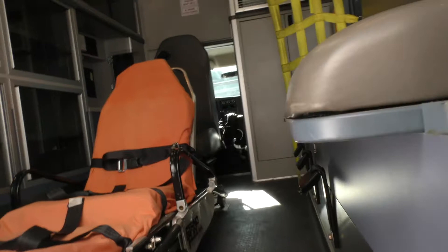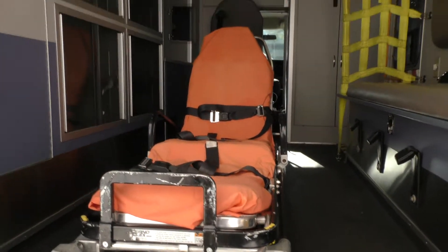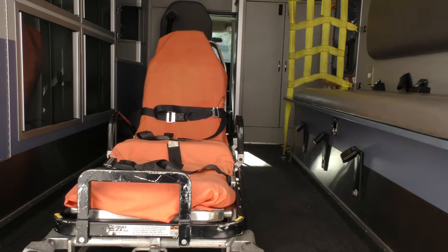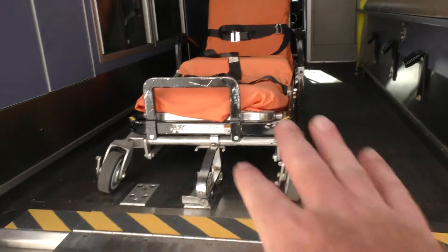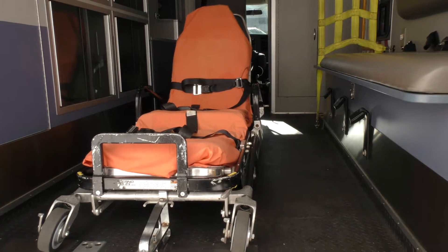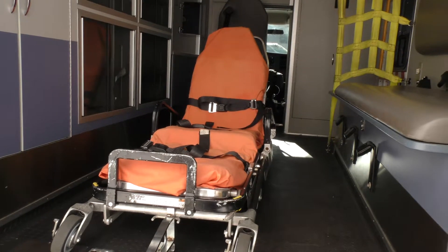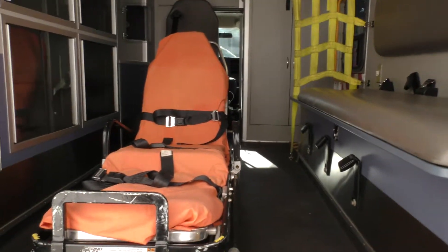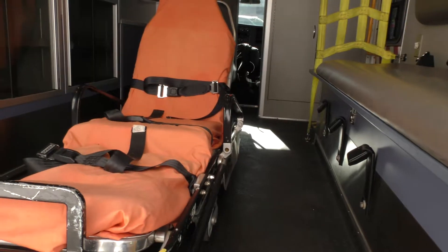It does include a gurney. This ambulance is set up for a one-man gurney — it's a Ferno Flex 2033. If you're familiar with the Ferno Model 28, it's a variant of that. It's called a one-man gurney because it just takes one person to load it; it's got a collapsible undercarriage so when you pull the lever and hit the deck, the legs fold under automatically. It does have floor mounts for a Stryker — MX Pro, Power Pro, or Easy Pro — with side floor mounts and antler mounts. The floor is rubberized diamond plate in perfect condition: no scuffs, no tears, no cracks anywhere.